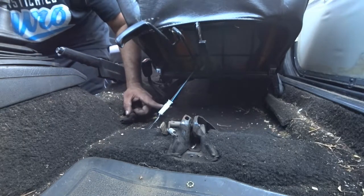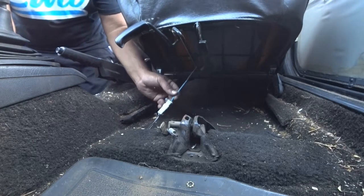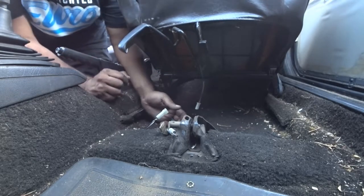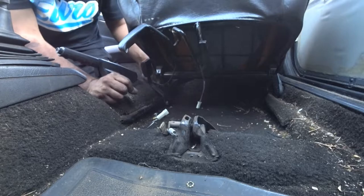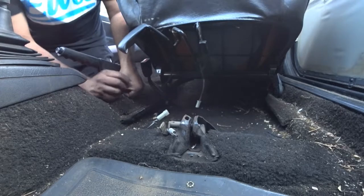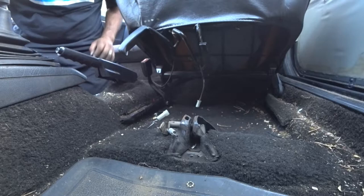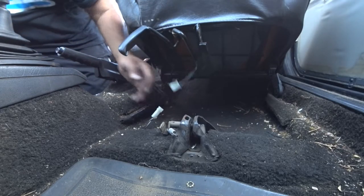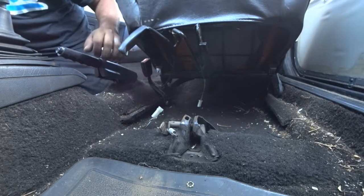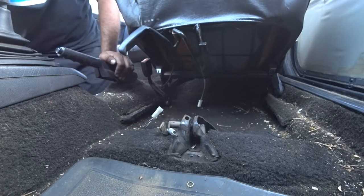Now be careful — I don't even know what this is for. I think this is probably the sensor to tell that there's someone sitting here, but airbags weren't an option in these cars back in the day. Actually, no — this is the seatbelt warning light. This tells you that you have your seatbelt disconnected. It's just a two-wire warning to tell you the seatbelt is disconnected. Same process: just pull the seat all the way back outside of the sliders and pull the seat out. That's the process for the front seat removals.